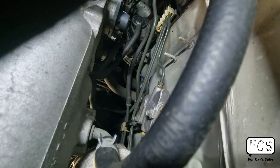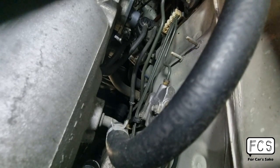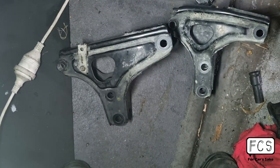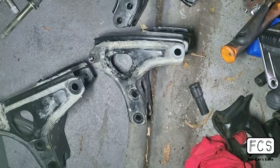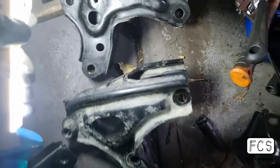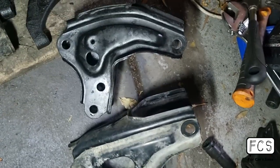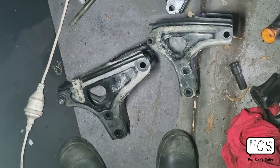Could have done it when the gearbox was out, when the drive shaft wasn't in. And now I have to wait. I swear there's nothing worse than being in the middle of doing something and then realizing your part is wrong. So I just learned the EG T-bracket is different to the EK T-bracket — manual obviously. And from the manual one to the CVT one, you can see that hole there sort of droops downwards and that's why it doesn't fit. In case you don't know, the T-bracket is different between the EG and the EK because the subframe is different.